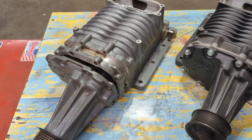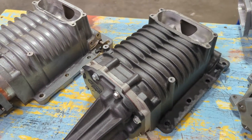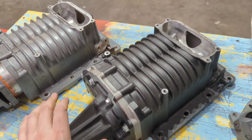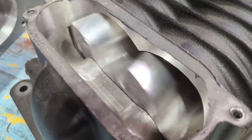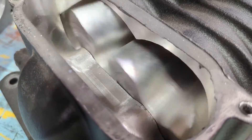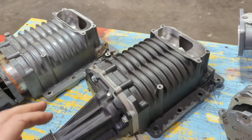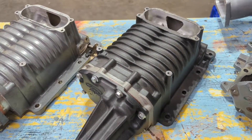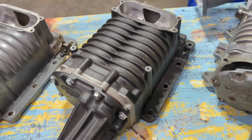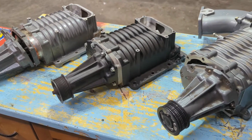That was an 8-pound pulley. I sent it off to a place to get rebuilt and CNC ported. It was supposed to be full max effort, but it lasted basically another 10,000 miles — not far. Then I bought a second blower. It looked pretty ugly but was a usable core — all the rotors were fine. I sent it off to that same place, got it rebuilt, ported, and actually painted too. And it quit as well. So I've had some experience with these blowers and kind of been through it.